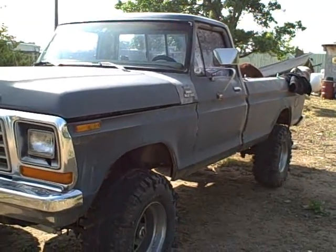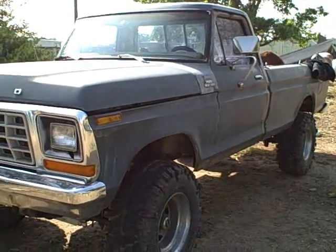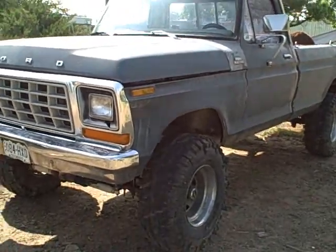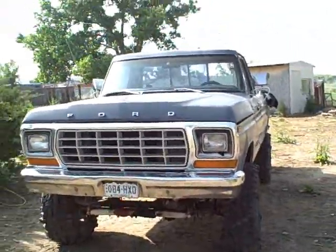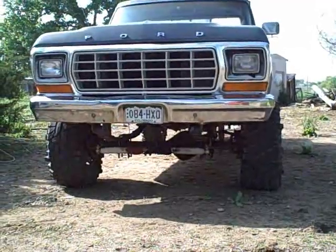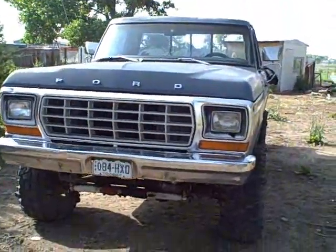The book says 365 horsepower; I figure it's somewhere between 365 and 400 horses. It has a Dana 60 rear and a Dana 44 up front, with a four-inch Super Lift with Skyjacker components including a dual steering ram up front to stabilize the front end — because it wobbled badly after I got the lift put on. Skyjacker shocks all the way around.